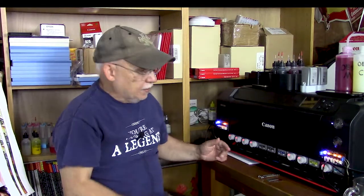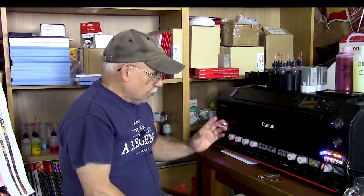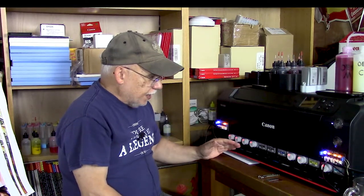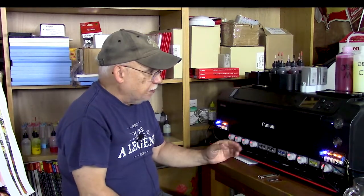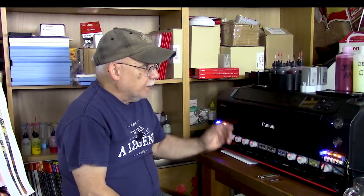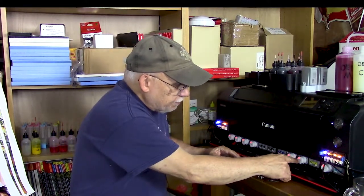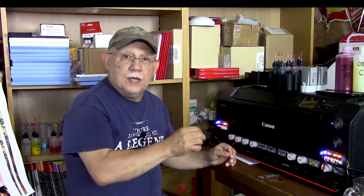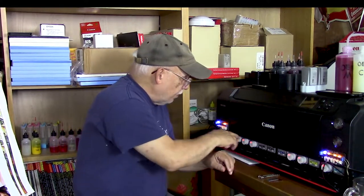Normally, we're going to proceed. I have a few more cartridges to set up and then we're going to print some black and white images. I'm going to use black and white mode because I want to use up the 5 ml of extra ink I put on that gray tank. That gray tank originally had 20 ml, which I used to calibrate my seven sensors so that they detect 20 ml — they'll either go on or off when I tap them.